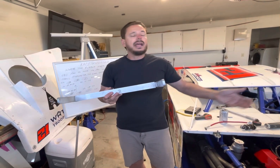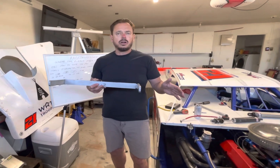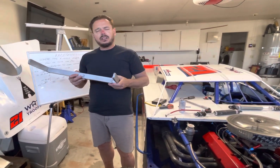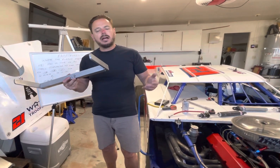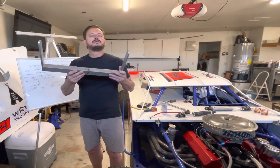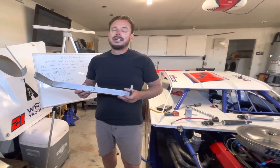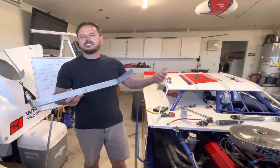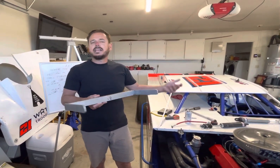Typically, what I do with stagger is I'll run half of whatever I'm running in the rear. What dictates your total stagger is the size of the track and how tight your corners are — it's all a radius thing going around the corner. You can play around with that. A lot of times you don't have the tires available that you need. When you go buy your tires, you can still measure them without mounting them — just measure at the sidewall to get a reference for the differential between tires. Once you mount them, those tire barns don't like to take them back, so get pretty close first. You can also use tire pressures to get stagger where you need it. You can use air or nitrogen — nitrogen won't expand as much as it gets hot, so you have to take that into account.